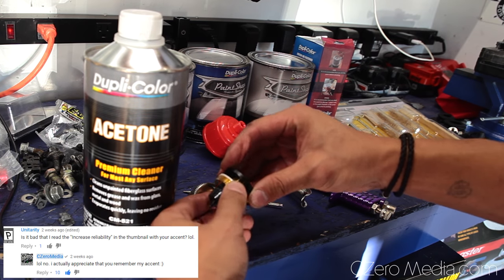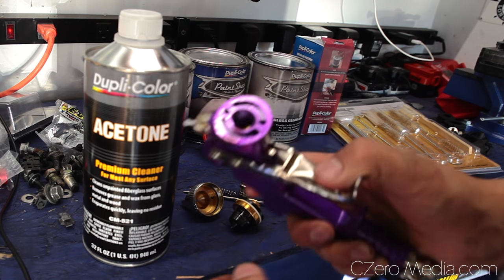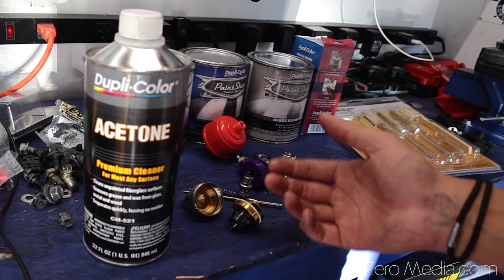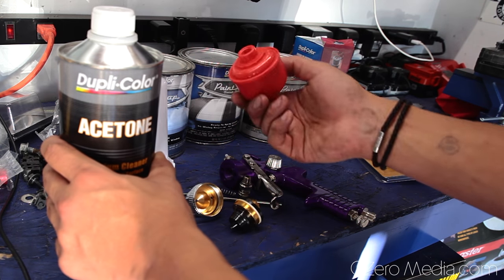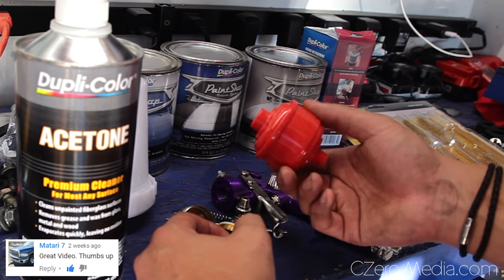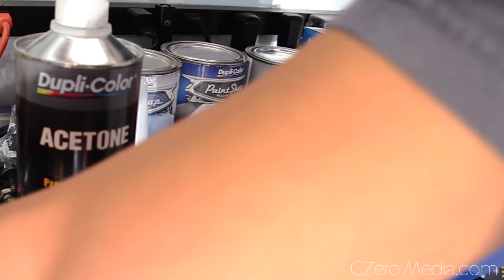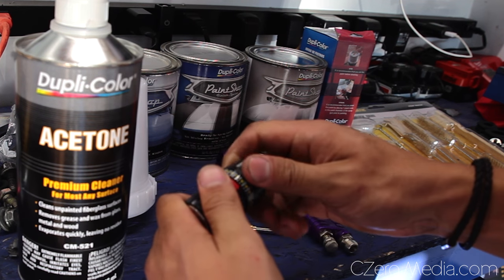What I'm going to do now is dump the paint gun parts into a solvent and make sure it's all clean of grease. You can see the grease here — this is the stuff that's going to get in your paint and ruin it. That's why a lot of people online complain that cheap guns don't work, but in reality they work great; you just have to prep them right. I also have a filter to remove moisture from the compressor — you don't want any water getting into the air. Attach it at the bottom of the gun and use a pressure regulator set to the correct PSI.